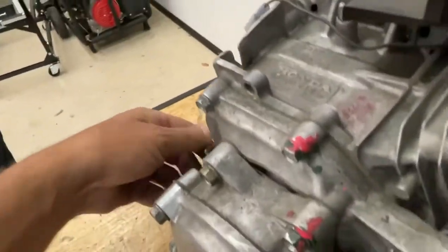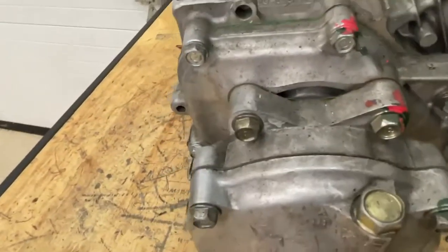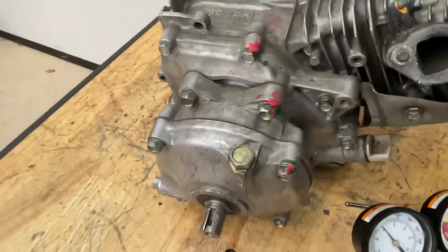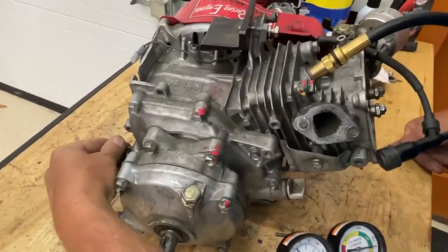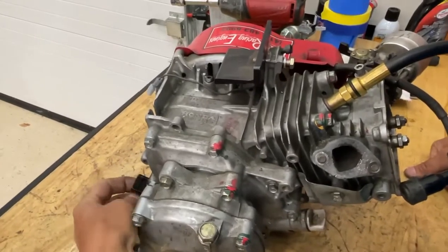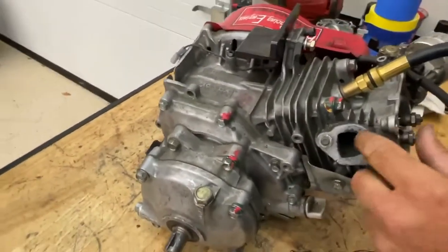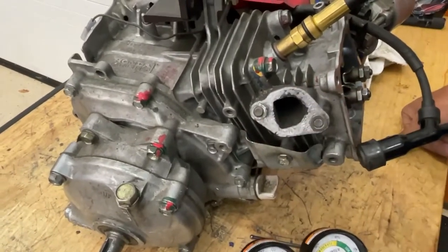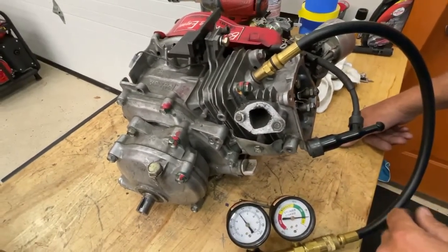If you come around to the back here and take the drain fill out, you can hear that leaking — it's hissing a little bit. That's always going to leak or hiss because the ring gaps in these engines are so big that you're always going to hear it in the crankcase. The big thing is the exhaust valve, because it gets so hot that it warps and needs to be taken off and lapped periodically to have a fresh engine.